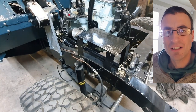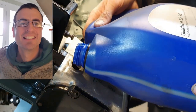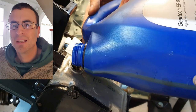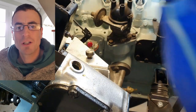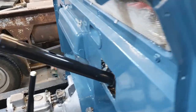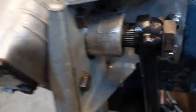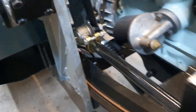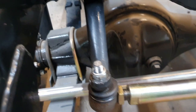Lastly, I pop some EP90 gearbox oil in the steering box — keep an eye on it because it just disappears. That completes the steering assembly. So you've got the steering column down into the steering box, the first steering arm with a push rod up to the steering relay, then down through the chassis to the next steering arm, another push rod to the left-hand wheel, and a connecting rod linking both wheels — that's the one you do the tracking on.